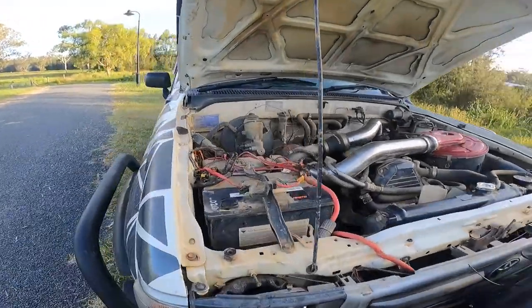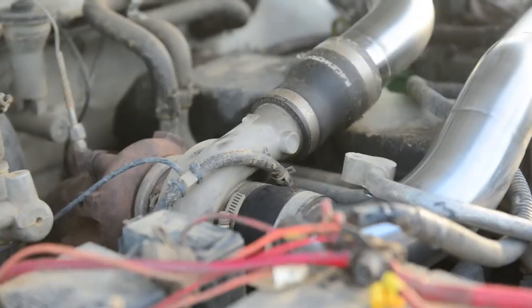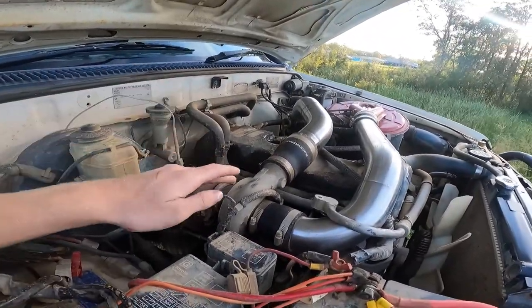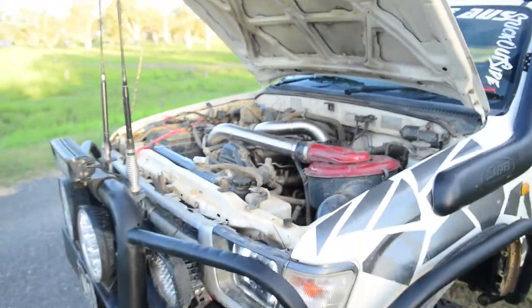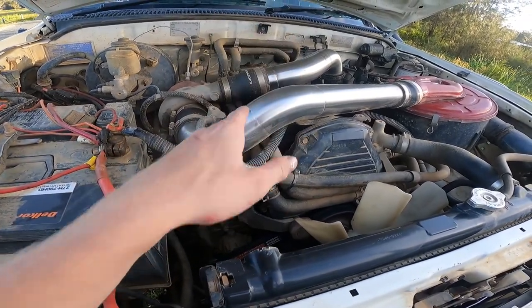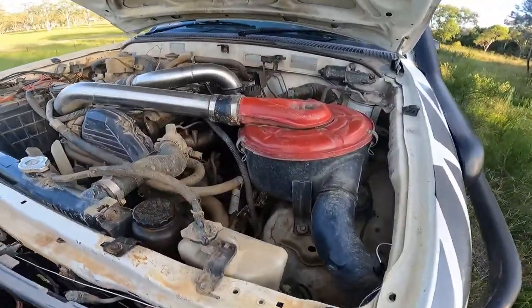Excuse the mud under here — this is the 5LE motor. Everything is pretty much stock other than the turbo and crossover pipe. The turbo is a standard CT20, chosen because it was cheap and I'm not chasing high boost — I'm running 9 psi. Pushing it further would risk blowing it up, and since I can't manually adjust fuel, more boost would just lean out the engine and overheat it. The crossover pipes and exhaust were done by SMF Fabrication. Worth noting: I no longer have aircon — that happened when I put the turbo on. If I did it again I'd leave room for it, but two years without aircon and it's not that bad.